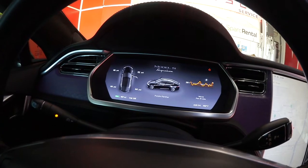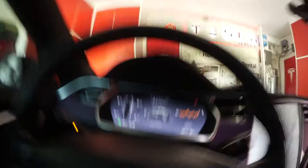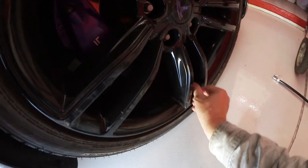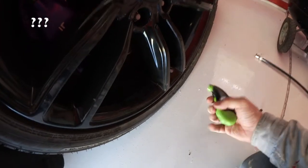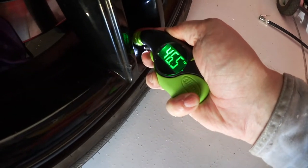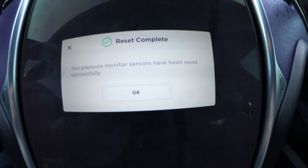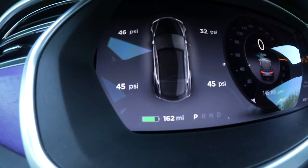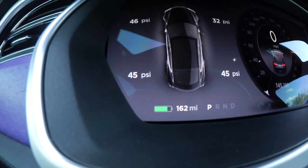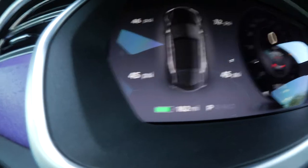Showing you the precision here. Front right reads 32 PSI. Now I've got this device and I measured it - front right. Take the valve cap off, press on PSI, plug in. It reads 46.5. There are 15 PSI difference. Watch this message: 'Tire pressure sensors have been reset successfully.' Still not correct. Driving a couple of miles, still shows 32 PSI. Should give me a warning for low tire pressure. Nothing happened - not a warning, not a wrong reading.